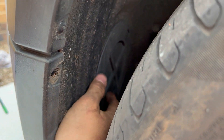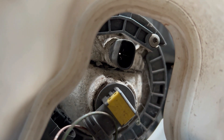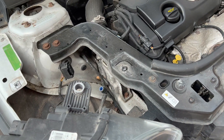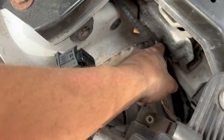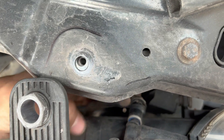Don't worry too much about getting the fog lights back in at that point, because at least one good thing on this Mini is the fog light access through the wheel arch — brilliant. When putting the headlight back in, just remember to connect up the power cable and your headlight washer. Go in from the back — dead easy to put the washer back on, get it lined up, don't force it; the last little bit should click.